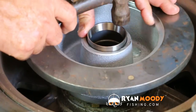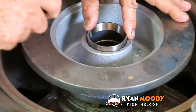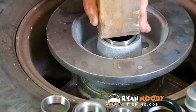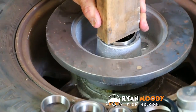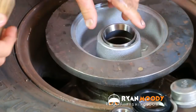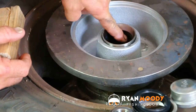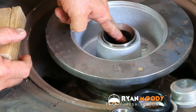Just tap it around the edges, just gently, to get a start. What I do is use a block of timber, just give it a good ol' whack. Keep changing the angle diagonally. Now we're almost down to the edge there. We can keep going until we go as far as the lip, but then we've still got another 10mm to go before the bottom of the sleeve will bottom out on that lip inside.